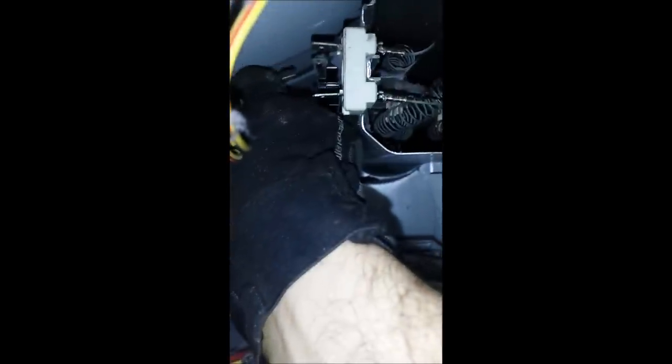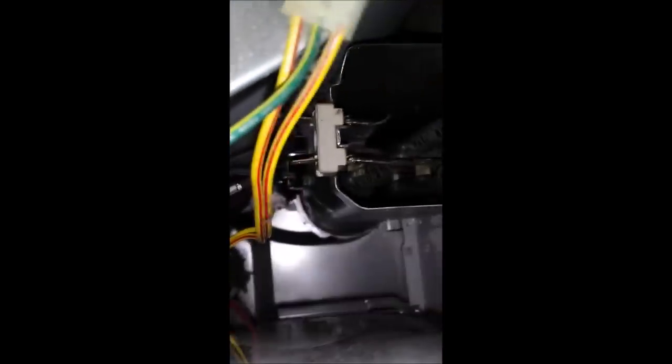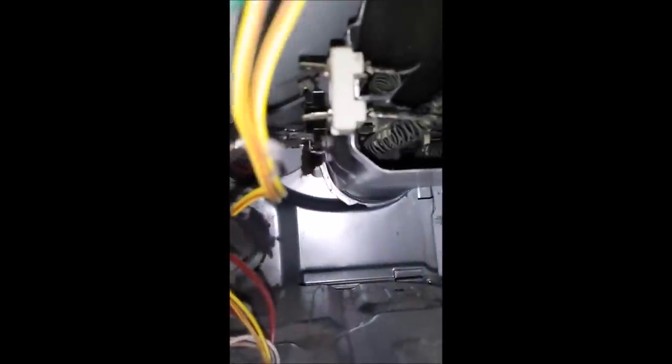We're going to squeeze and use both hands to pry these clips off - one and two - and then move on to the high temperature sensor. The top clip is the white one. This white clip connects to the top of the heating element up here, and the other end goes to one side of the high temperature sensor. In my unit, it's the top. We'll pull it out and take a look shortly.